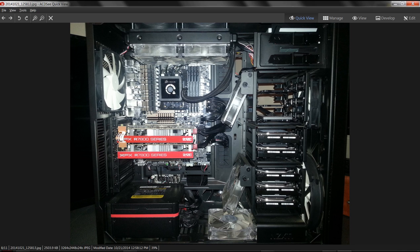A couple of 120mm Silent X fans here on angles at the bottom of the case. I actually drilled a hole through the portion underneath the drive cage - there's another 120mm Silent X fan there, and one to the left of it. There's a 200mm fan here, a 120mm in here, another 120mm up top that we can't see, and a 140mm on the back.